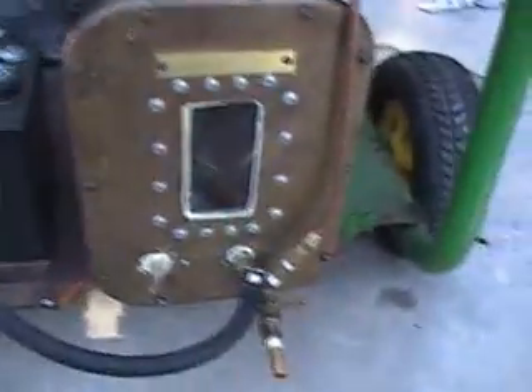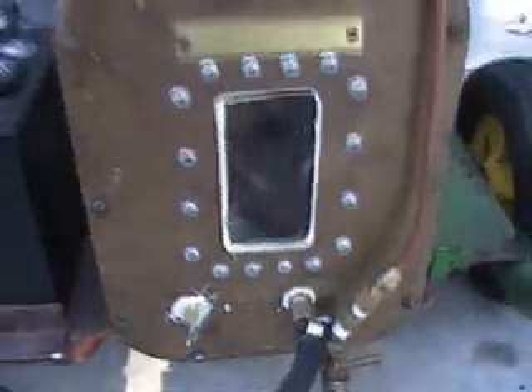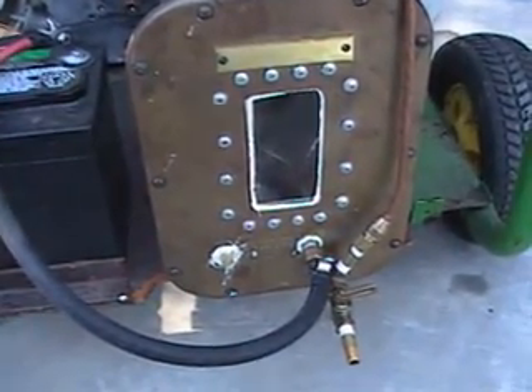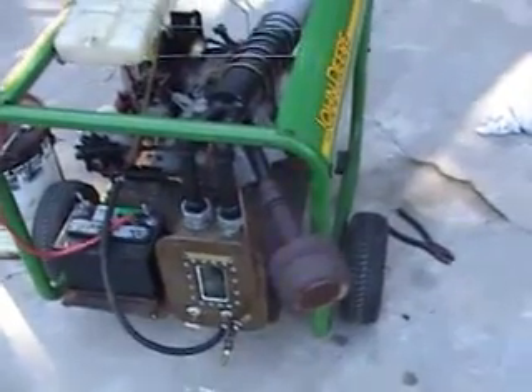It's an experiment. The bubbler is working good — I did have to do another modification. You can kind of see down inside there that there's something different: that's an actual eight-horse Briggs and Stratton float inside there, and that allowed me to go to a little bit lower fuel level in the bubbler. I've got almost half as much fuel inside the bubbler now. I couldn't go much less because of the temperature inside the bubbler creating too much vapor, so I tried to equalize that as much as possible. Anyway, that's today's test.